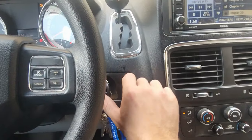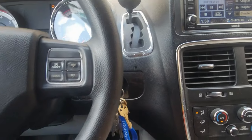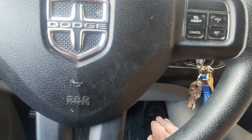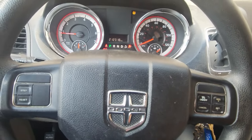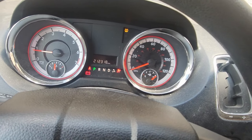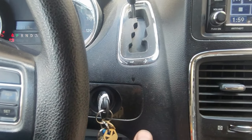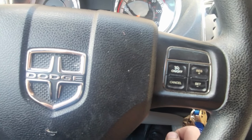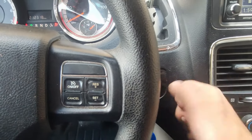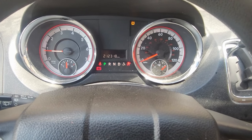So that's how you do it — two clicks to the on position, don't start the engine, and three deep presses of the gas pedal without going too fast, because it has to register in the system. If you go too fast it won't reset. After each failed attempt, just start over: turn the key off, back on, press it three times with about a half-second space in between, then shut it off and start the vehicle to get the system to register and reset that light.